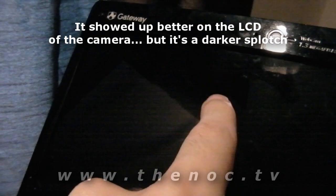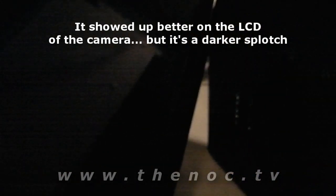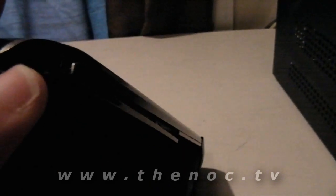See, I got that little bit of discoloration there, a darker spot compared to that. You got some here that's actually broken crystals in the screen. And if you go along the side here, you'll notice that the plastic is busted. The actual screw is kind of popped out of this one a little bit. See, chipped off corner, broken down the seam there. All that good stuff. When you have a laptop that is broken like this, where it's not just the screen but the plastic on the outside, it's best just to replace the entire assembly.